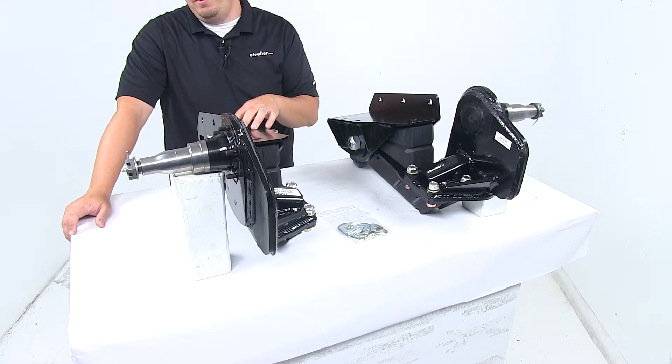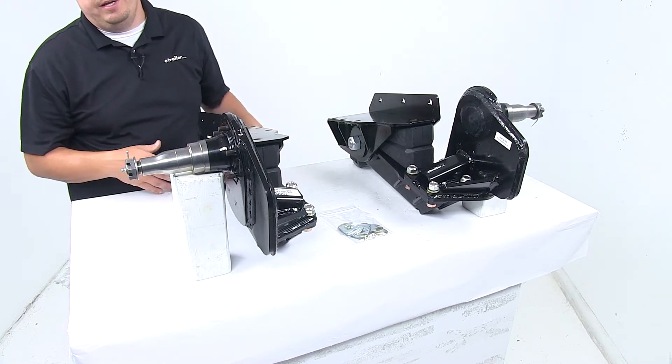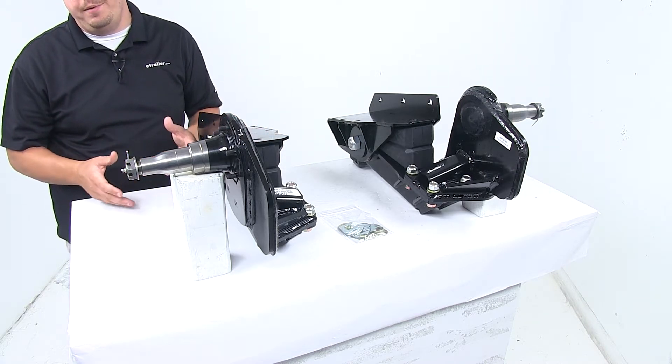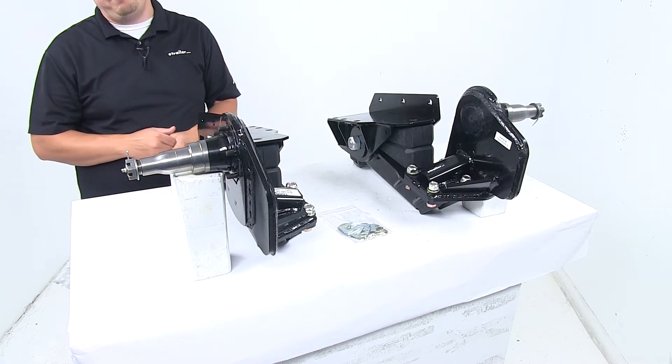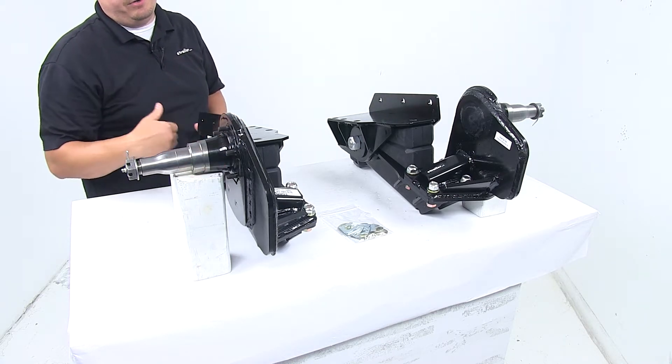It's designed to fit one axle and two axle trailers that use regular tires. With this part number you get two suspension units without hubs, and they work with 6,000 pound hub and drum assemblies. The brake flange is a five bolt configuration.